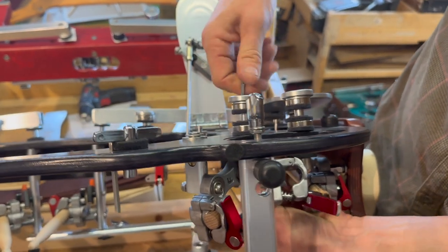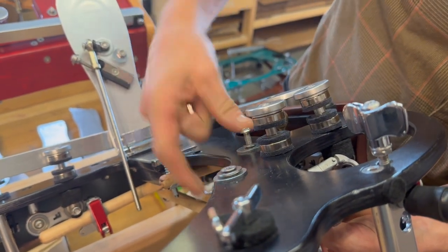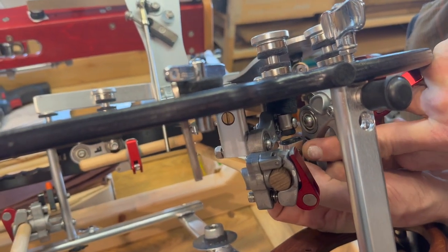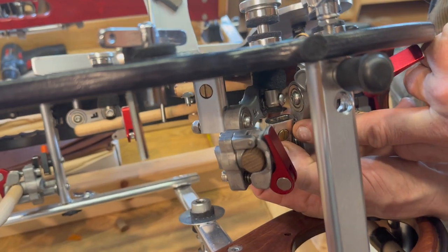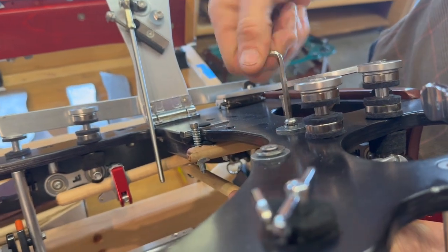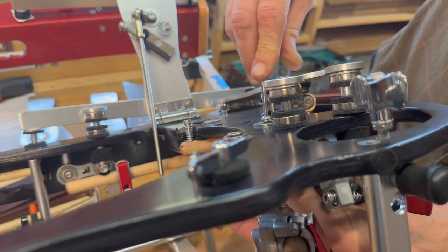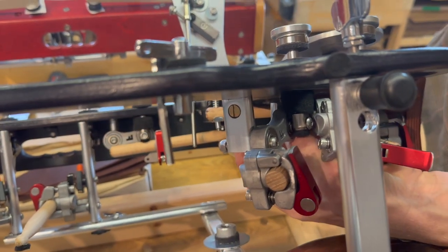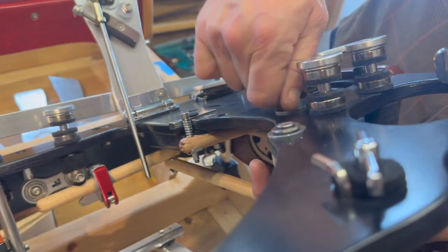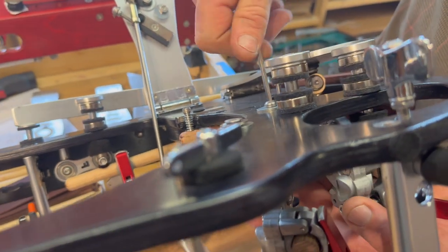Taking that off, I'm going to do the reverse engineering thing - take it off and put it right back on. So what I have here is a button head bolt, a lock washer underneath that, and a fender washer - those go into that hole. I want to make sure, just like in our other video on the 9 to 12-pedal conversion, that that slot is up. And then I'm going to hold that slot - or it'll come with tape on there to hold it for you. I found the threads - sometimes they're kind of hard to start, so this is why I say use your fingers, so you really know that you're on there and threading pretty easy.